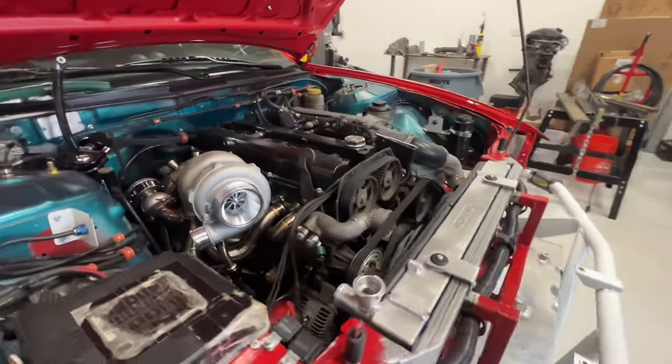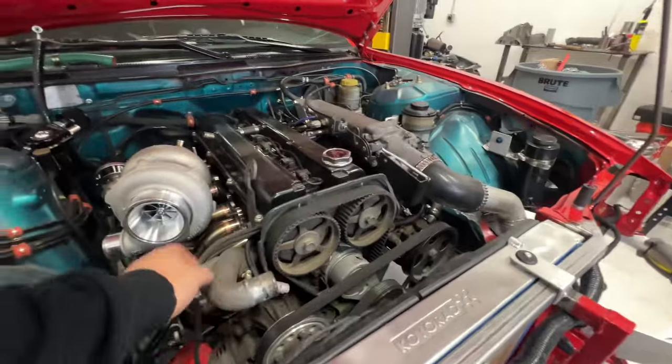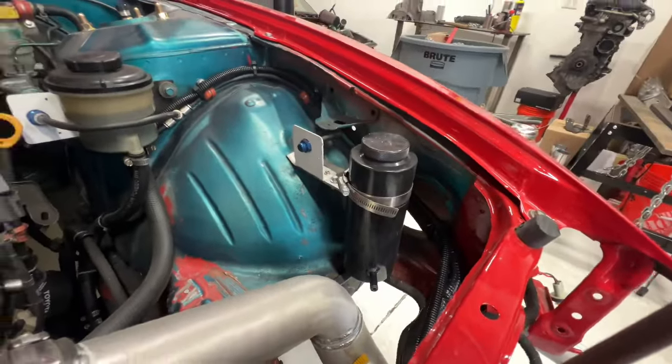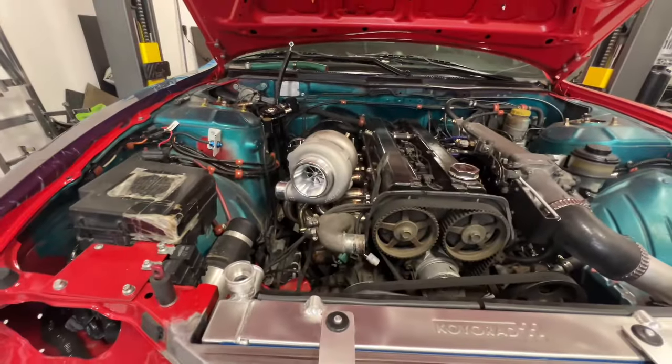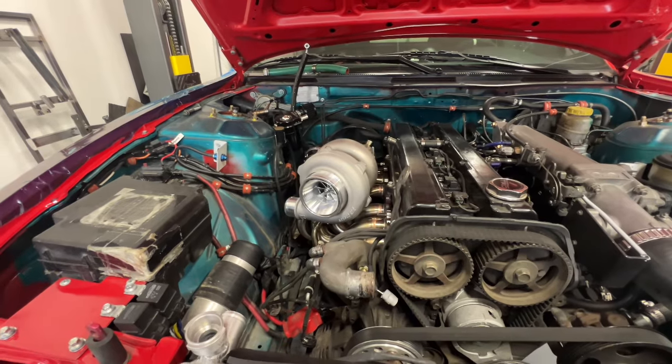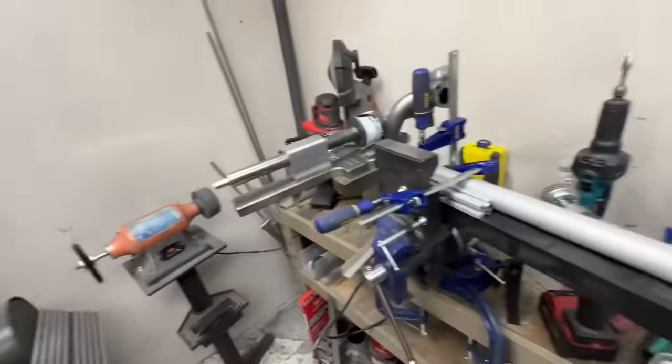And yeah, the only one that's gonna have a pressurized cap will be the one on the swirl pot, and that's gonna go to the overflow in case that ever over pressurizes. So only one pressurized port on the system, not two. So I didn't want to get too wild on the tube notch here, but kind of got a little wild setup going on now.